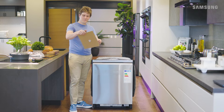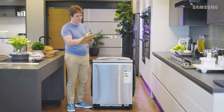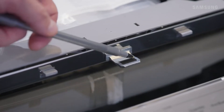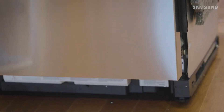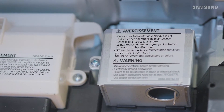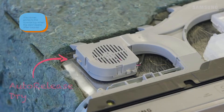Bill, I hope you like checklists, because we've got a lengthy one for mechanical and plumbing inspections: the plastic base assembly, the dishwasher feet, the door latch, hinges, and the hot water connection on the back left side of the base — all that stuff has to be looking perfect. Electrical components should also be in tip-top shape. Make sure the junction box cover is secured to the junction box on the front right side of the base, and the electrical box and control panel should be damage-free.